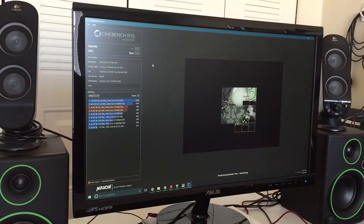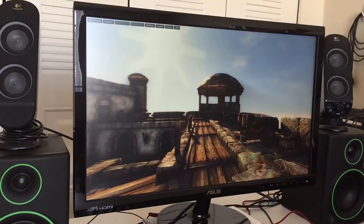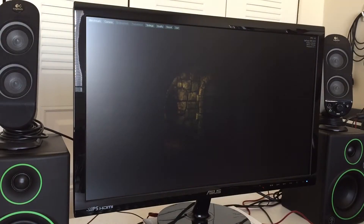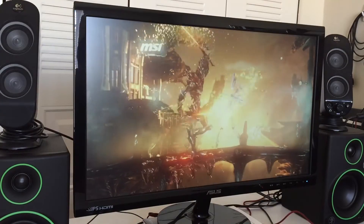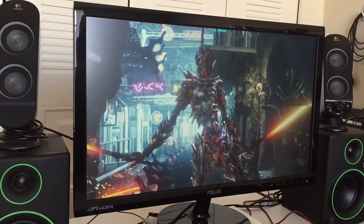In addition I also ran a Cinebench test. It's a very light CPU load, but whenever I overclock to a new clock speed I run Cinebench first because it's really quick — if the system crashes right away I can tweak it immediately. Cinebench is also a good benchmarking tool for the CPU. For the GPU I ran Unigine Heaven benchmark loops for about 20-40 minutes to heat up the GPU, then ran the benchmark test three or four times to get an average. I also use 3DMark Fire Strike, which tests the GPU, does a physics test on the CPU, and a combined test.